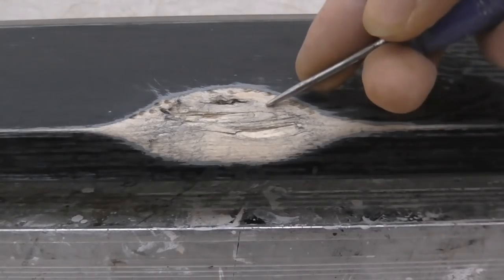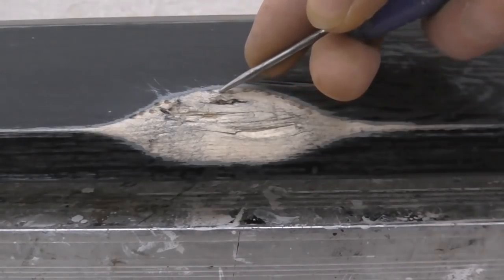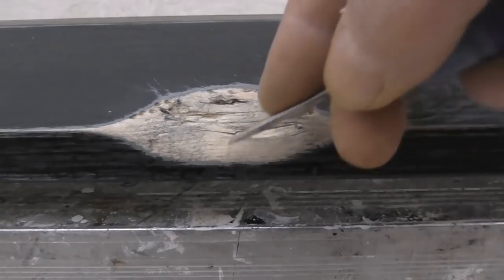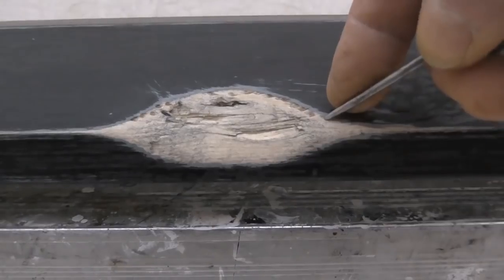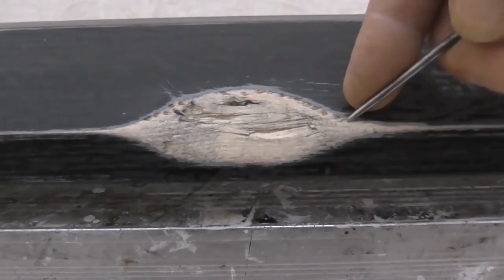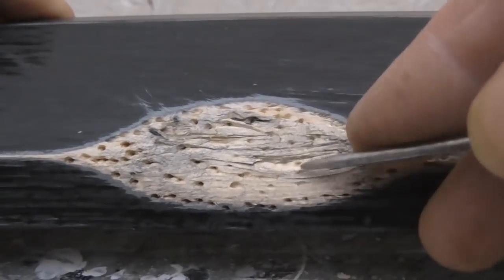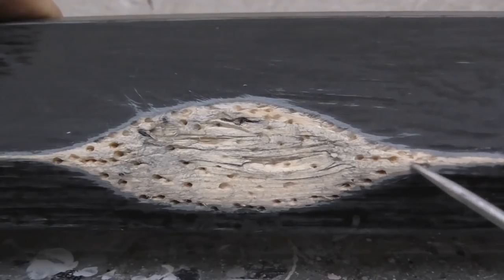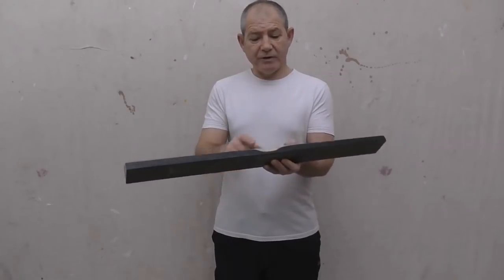Using my brad awl, I want to create a series of holes just along where the wood is exposed. I've already started doing it there, and then generally across the whole surface — literally just pushing it into the timber a bit. When you've finished, it should look something like that, right up to the edge. This is prepped and ready for filling now.